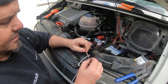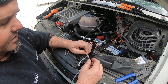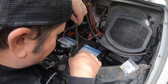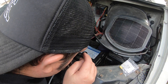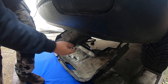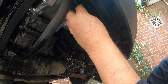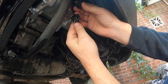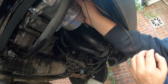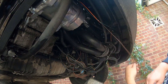I'll join those two together like that, give them a twist, and make sure the solder is positioned over the center. I'll feed this down next to the headlight loom so that it goes all the way down to the bottom and I can run it to the compressor. There's the plug on the compressor and this is the plug from the dryer. Lining these two up — green, brown — click, click. And there actually is a little slide mounting point up there. Nicely done — that is connected.